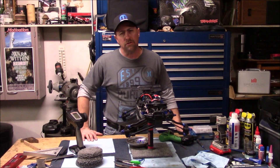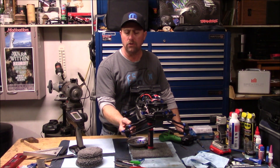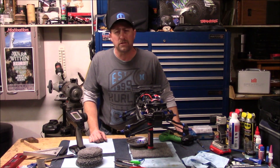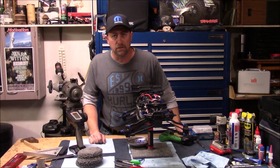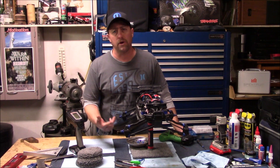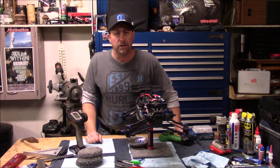And that's it for this video, guys. That concludes our video on the steering adjustment. You're probably going to want to go ahead and adjust your toe links here for your steering knuckle on the toe in and toe out. I've got a great video on that as well — it's number one in my video series, adjusting camber and toe in alignment. You're probably going to want to take a look at that so you can get everything really straight and lined up. The straighter things are, the smoother they run, the longer they last, the less wear there is — it's just better for everything to run as straight as you possibly can. It's good for your tires, your bearings, everything.